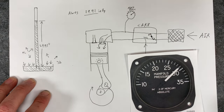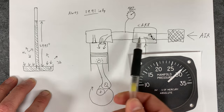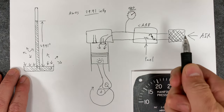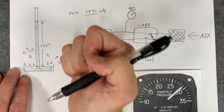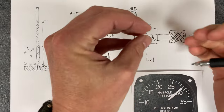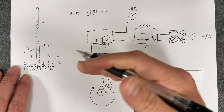When it's sitting, manifold pressure reads near atmospheric. When you start it, it pulls the needle way down — below 10 even — because it's got a high vacuum on it and has pulled the pressure that the atmosphere exerts on this whole system way down. But then you push the throttle in to take off. What you've done is opened the throttle up, and now when that piston comes down for a breath, instead of sucking real hard against a nearly closed valve, it's got an open valve and a pretty free air filter, so the air just breathes in real fast. It doesn't develop a lot of vacuum. Therefore the manifold pressure does not suck down — instead, when you open the throttle up, the manifold pressure goes up.